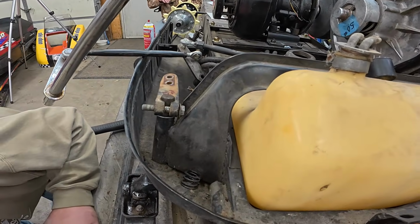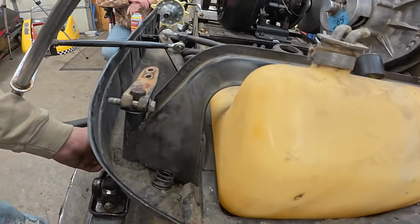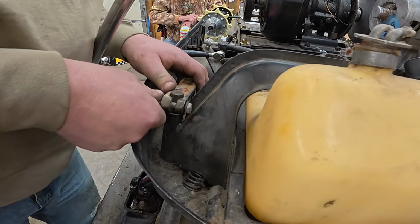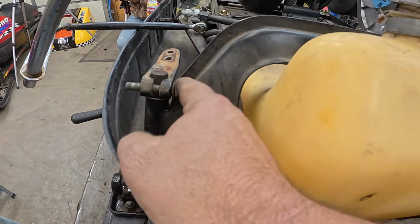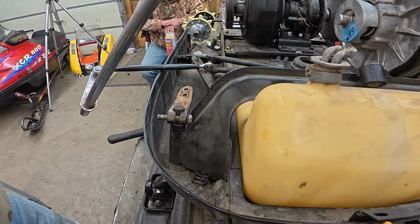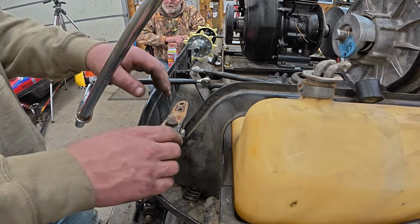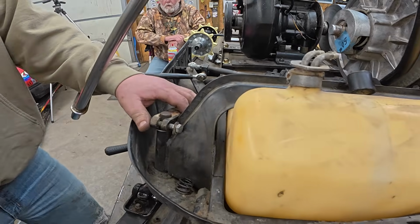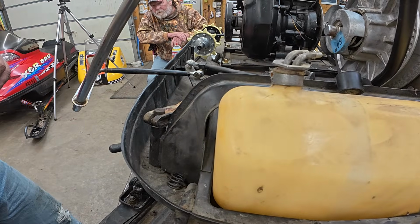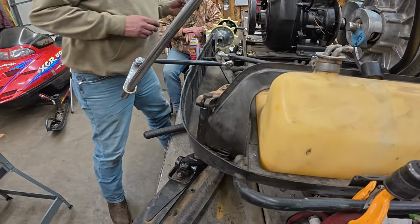Apparently, this is a year difference. Greg says this setup with that spindle and that arm is different in a later Elan SS? A '74 Elan SS. Well, you can see it's not going to turn very hard, and that's where the bolt head is. Easily fixed with the grinder. The grinder will take care of that, on the bulkhead or whatever. Yep, we'll just shave off that pinch weld right in the vicinity of where the bolt goes. No biggie.